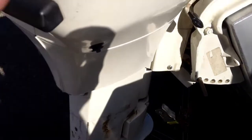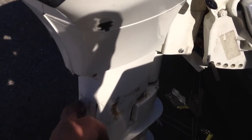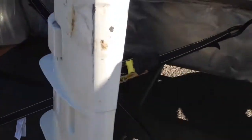The front end comes out of the water, and then as the water starts coming faster, the drag hits the motor itself and it slows back down. So what I decided to do was put a belly pan all the way across.